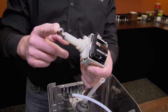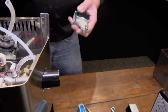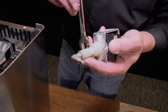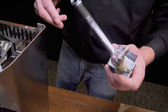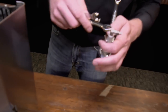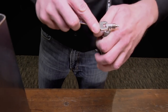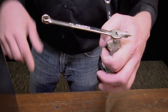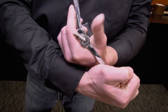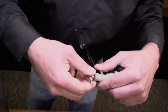Next we have to take this elbow off the pump so we can put it on the new pump. In order to do that, we need the 12 millimeter wrench — you'll see there's a slot on both sides of the neck. Force the 12 millimeter wrench on there; it barely fits but it will go on. Then we're going to use either the 9 or the 10 millimeter — the 9 is really tight and won't move on there. Basically we hold one wrench and break the elbow free on the neck. Once you get it free, you can actually just spin it off with your finger.